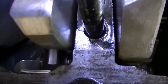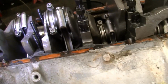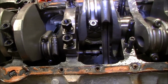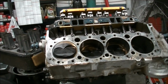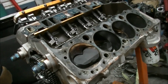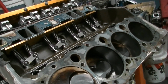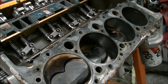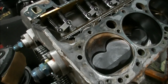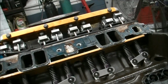This fella too, you can see the crack. That's foobarred in a big way. So we just need to know what the guy wants to do with it now. Well, I've got a message from the guy who owns the engine, and he's going to bring me the 400 block back. Just having a bit of a look around. We'll need another set of pistons. The rods are good, 6-inch rods there. The crank will be okay with a quick machine. Pull the cam and just have a look at it, but from all accounts, she looks alright.